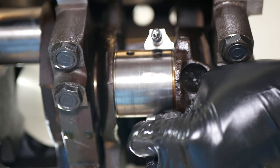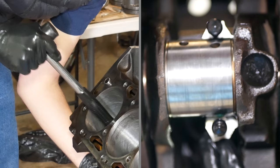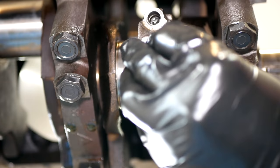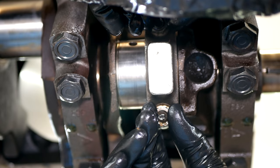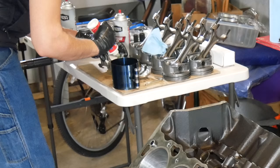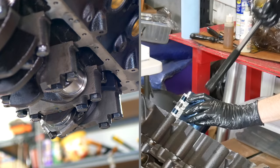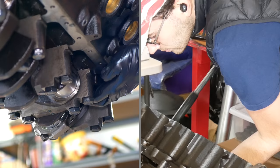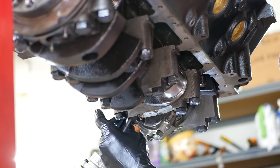I didn't feel like checking all of the connecting rods — mostly I was just being a bit lazy — but we're going to leave it at just measuring the one. We do have to knock this number one piston back off the crankshaft to apply some assembly lube to the bearing, but once that's done and we tap it back down we can reinstall the connecting rod cap for good this time. We'll just get the nuts snugged down and we'll go through and torque them all at the end. For now we'll work on getting the other seven pistons into the block, applying some assembly lube to the bearings while they're on the bench, then getting the ring compressor in place, the piston dropped into the cylinder, and tapping it in, then pushing it all the way down onto the crankshaft and lightly tightening down the cap.